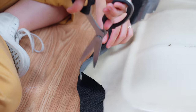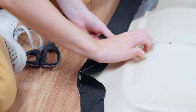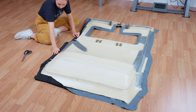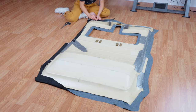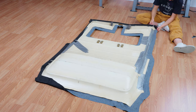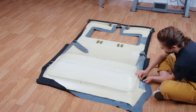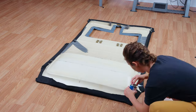Once they are tacky, pull the fabric up and over the edge into place. Use scissors as needed to cut the curves and corners of the fabric. Since most edges will be covered by trim pieces when installed, we don't have to worry too much about appearance — we just want to ensure there aren't any wrinkles showing and that the material is tightly held in place. Since every headliner has different curves and corners, the goal is to minimize wrinkles with a secure hold.